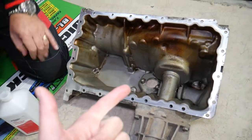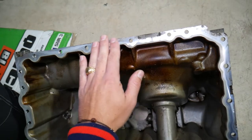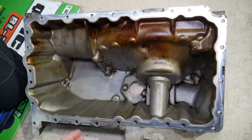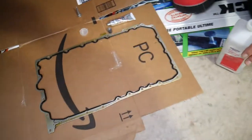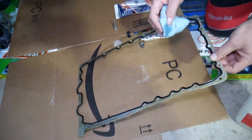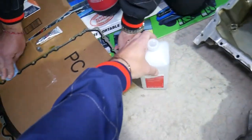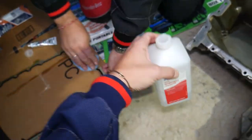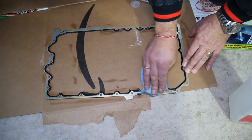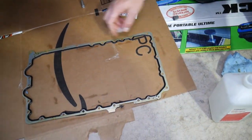So you need to remove your oil pan and find out whether you have a gasket or not. If you don't have a gasket, you need to clean the oil pan really good — even use a scraper and a little bit of fine sandpaper — clean everything, clean the engine block, apply silicone, and get it tight to the torque specs. If you do have a gasket, you need to replace it. But if you don't want to buy one, you can still do it without a gasket — we'll use pharmacy alcohol to clean everything really good. It was like liquid gold during COVID time, but it's probably cheaper to buy a gasket than using alcohol right now. You get the idea — you need to wipe everything to make sure it's not greasy and everything is nice and clean.